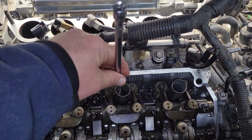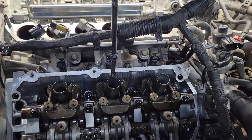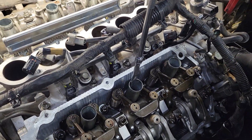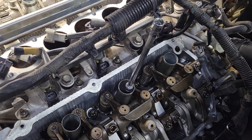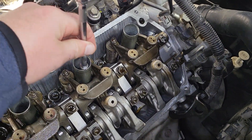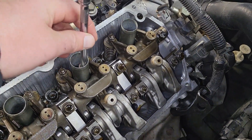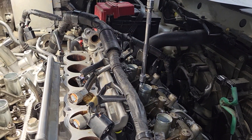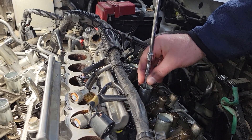You can visually see cylinder four and cylinder one at top dead center, following the same stroke. Now we're going to turn the crank and watch the piston go up and down, looking for cylinder four to come back up to top dead center compression stroke. Be careful: the way the engine is tilted, whatever you use to check the piston can get stuck between the spark plug hole and the piston, so be mindful letting it free-ride.